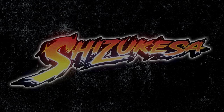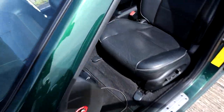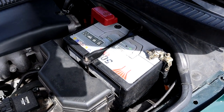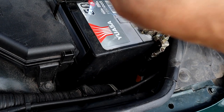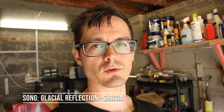I've started by moving the seats back as far as possible. I've disconnected the battery because they're electric seats. Now I'm going to disconnect the negative terminal to make sure nothing shorts out while doing the wiring underneath on the gearbox. When working with mechanical stuff you want to isolate everything you can, even though it's unlikely with the keys out — just be safe.